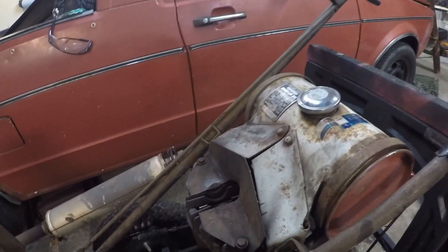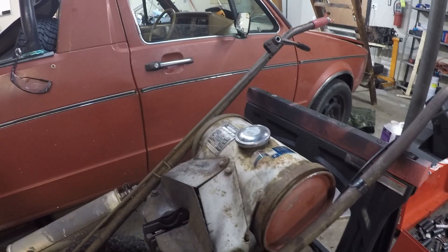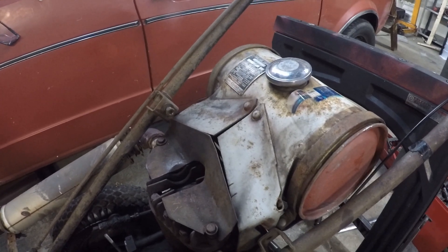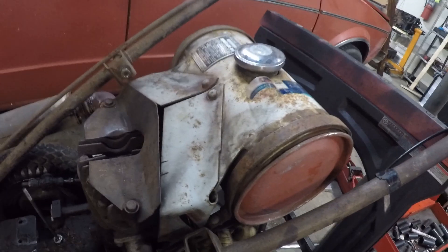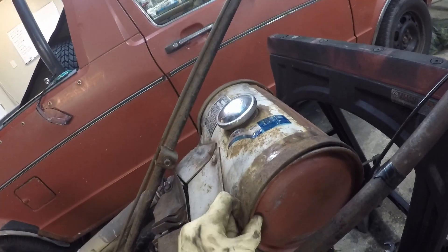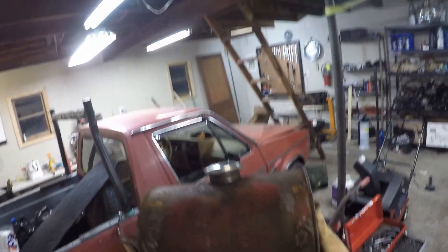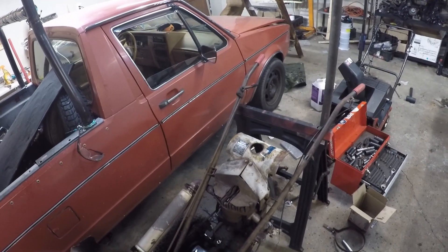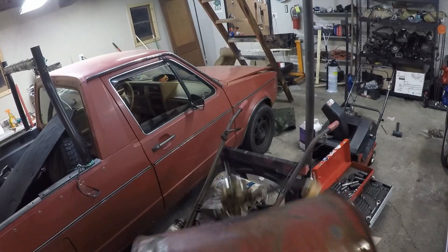It's time to start pulling these handlebars off. There is a nut on the back end of this thing, so be sure you get it. I've also got this sawhorse so they don't come crashing down. Now it looks like we've got this gas tank being held on by 7/16ths in the front and a nut in the back for both sides. Got the gas tank off. This is pretty sweet — I wish I'd filmed it because a big spring-loaded clip just went and it went flying off. It's a miracle this glass filter thing didn't crack, but hey, I'm lucky like that.